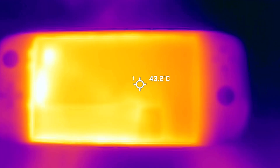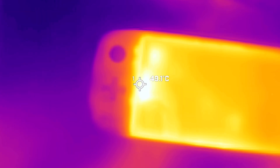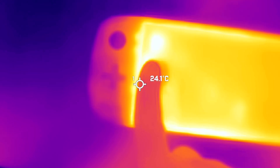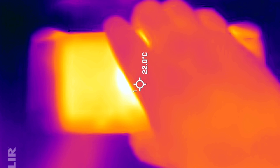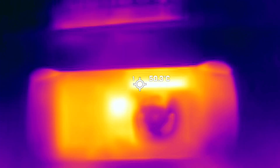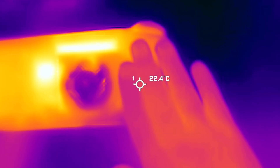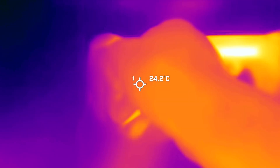Let's take a look at what the device looks like at 10 watt running in a portable state. At 10 watt, we're going to get much better battery life — looking at closer to two and a half hours of battery life, which is far better in a portable state. If we take a look at how much the heat radiation is going out, because we are making less of a demand at 10 watt TDP, we're looking at around 17 watts total demand being pulled from the battery. At that discharge rate, the battery doesn't actually heat up as much as when running at 20 watt. So at 10 watt, the device is far more comfortable to hold in the hand.